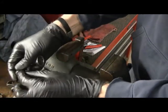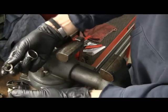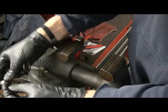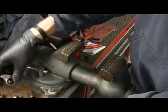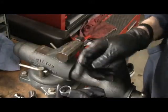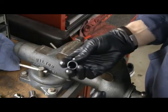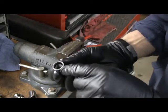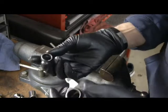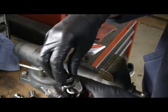Here is the stock one. There's nothing that encapsulates those bearings. It's a two-piece retainer, and they come out really easy. So again, the new bearings are not a two-piece. It's essentially a one-piece cage that holds them in. Very easy to assemble. There's writing on one side of the bearing and no writing on the other side. The instructions tell you 100 times, make sure the writing goes to the outside.